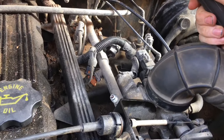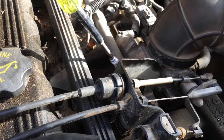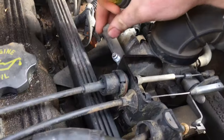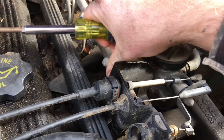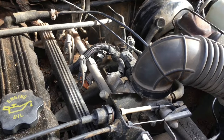I actually already diagnosed this and I thought I'd just do a video on it. As you can see, take your screwdriver, push that valve down — there's no gas coming out of there. That should squirt gas. So that tells me that the valve in the fuel pump is bad. It's leaking back through your fuel lines and it's not holding pressure. That's why you're getting a long crank.